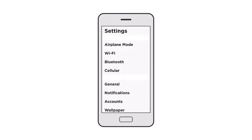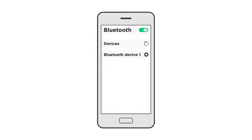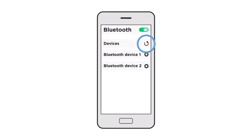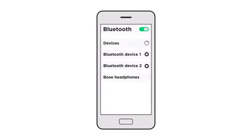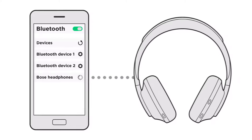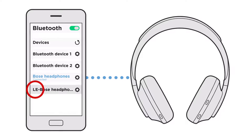Next, we need to put the Bluetooth device in pairing mode. Go to the Bluetooth settings on your device and make sure Bluetooth is turned on. Your Bluetooth device will begin searching for nearby Bluetooth products. You might need to tap a scan or refresh button to find your headphones. Once they appear, tap them to connect. If they appear twice, don't select the option that shows LE.